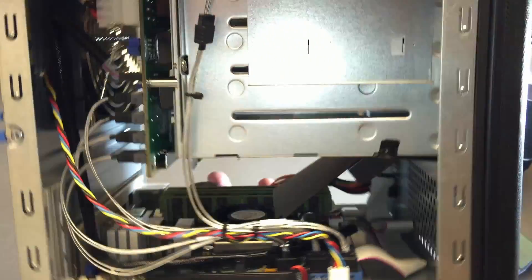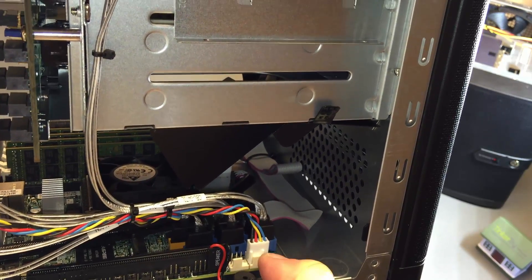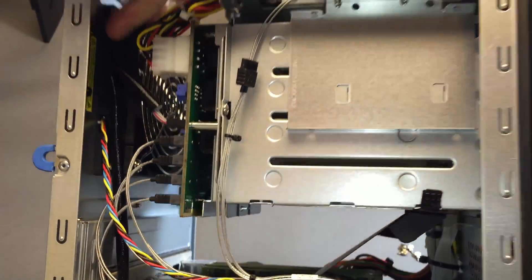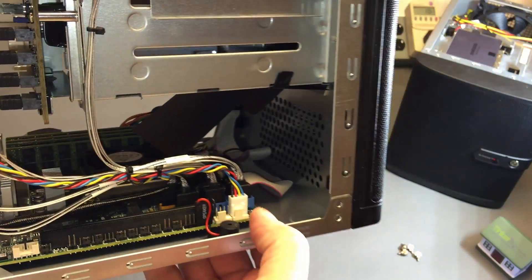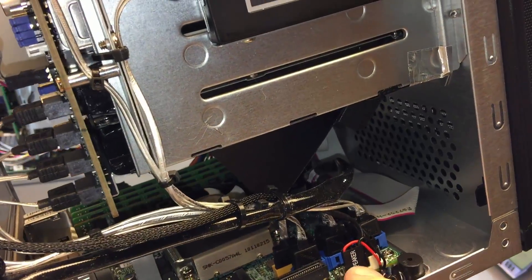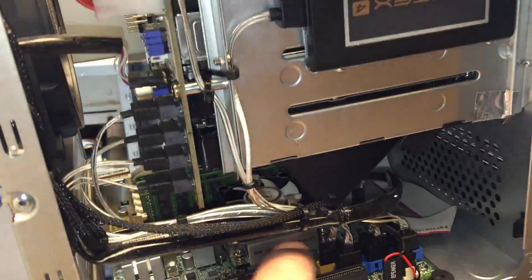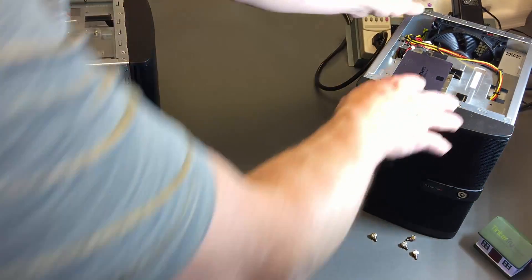How do you know you have a Xeon D1541 versus a D1540? Very clearly, you've got two fan leads up here in the front — one and two — and only the rightmost one is used, with four leads going to the chassis fan in the back. On the original system you have only one fan lead, so it's something they added on the Rev2 motherboard. The VRMs and the print on the shroud over the fan also look different. This one has an aftermarket GLID CPU fan and an aftermarket Be Quiet fan at the top, so the fan speed and sound you heard when I booted it are probably a little different — a little quieter.